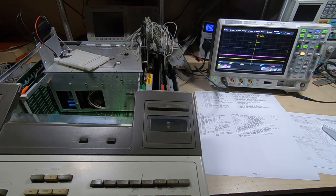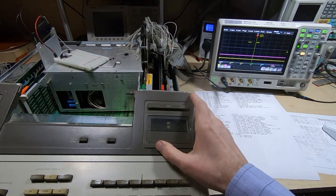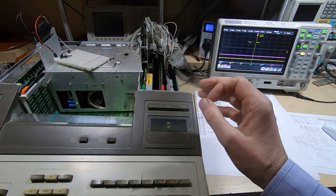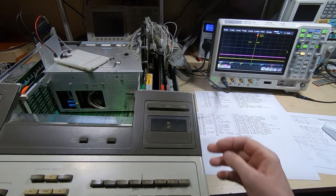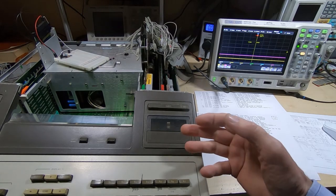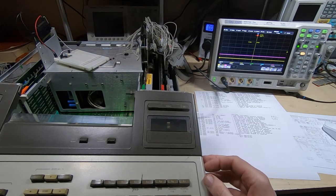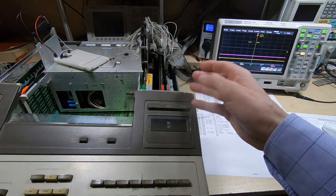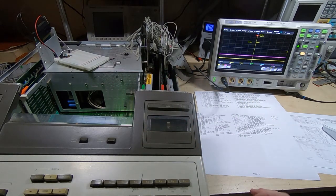In this series of videos I'm attempting to repair and restore this HP 9845B vintage computer. So far I've completely dismantled the unit into its major sub-assemblies and went through the power supply, fixed a few minor faults. But the system just won't boot up at all — it's almost completely dead. The two processors are now trying to go through their startup routine, but the PPU is failing to start up properly. The LPU does seem to be trying to start up, but because it interacts with the PPU, it's also failing to get properly initialized.